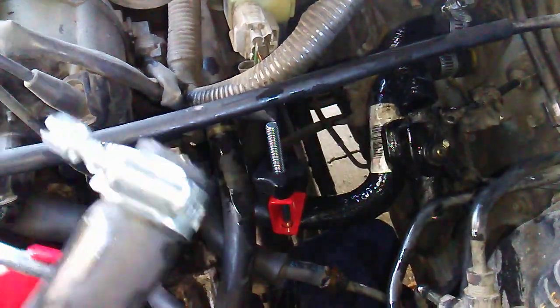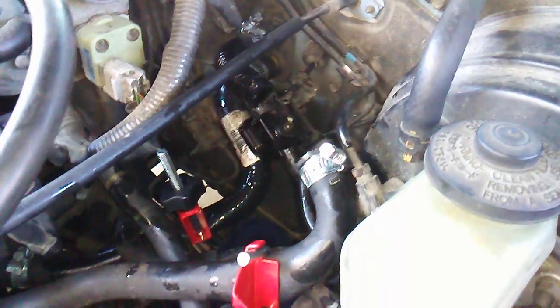Clamp down your hoses — it stops pretty much most of the leaks. Tighten it on pretty good. Tighten those on and work on a cool engine. Tighten everything and it should go back in a breeze, but again, you might as well just replace that bottom hose and dremel those clamps off.